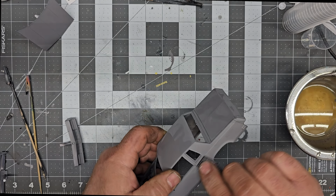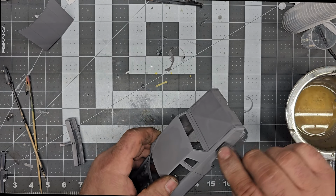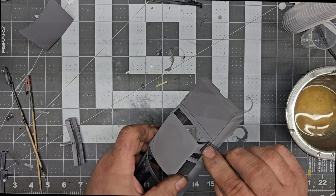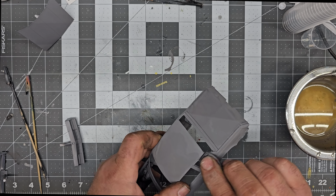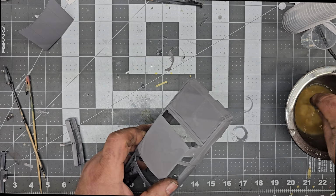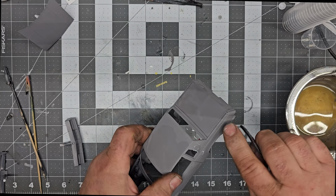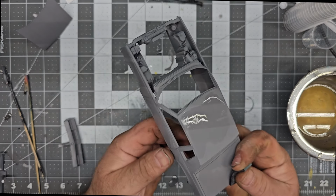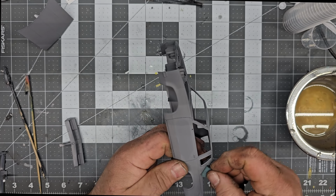That's one thing I do like about lacquer. My downfall, what I don't like about lacquer, is it's not that durable. It'll chip easy. Doesn't take much to walk away from things like lines, separation lines. Like this here, it'll burn through that super quick. Where enamel takes a little bit, so it's a little more forgiving.